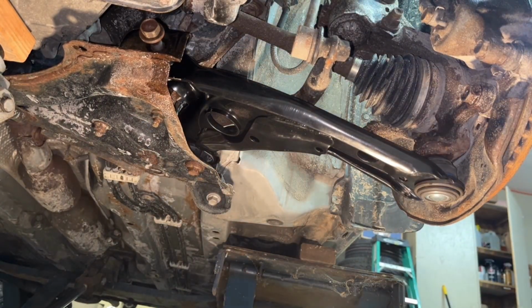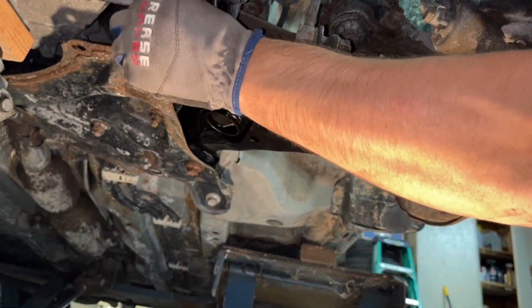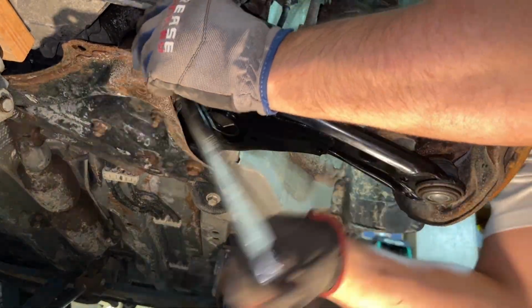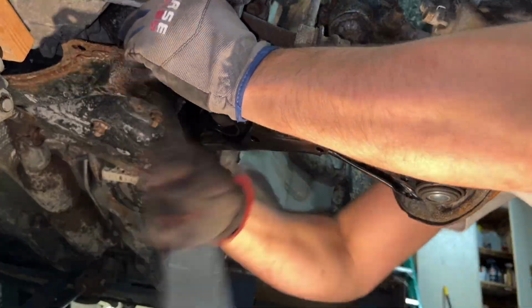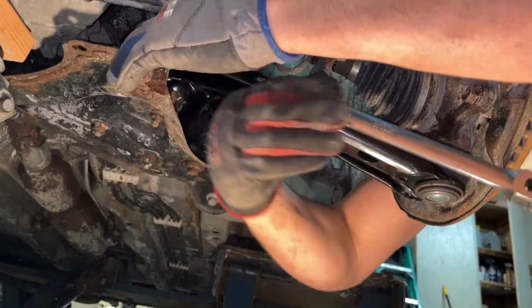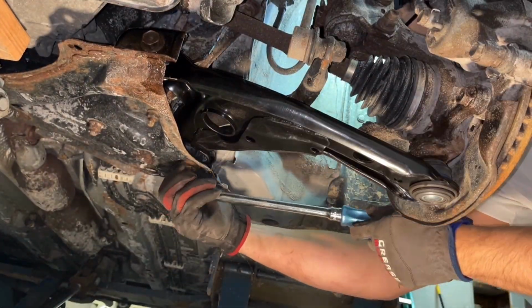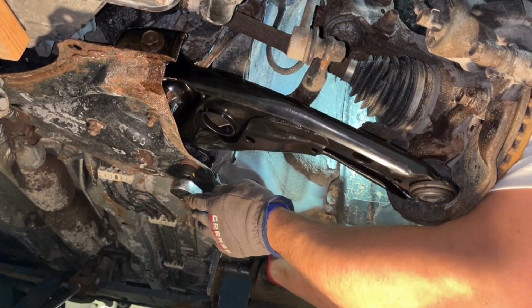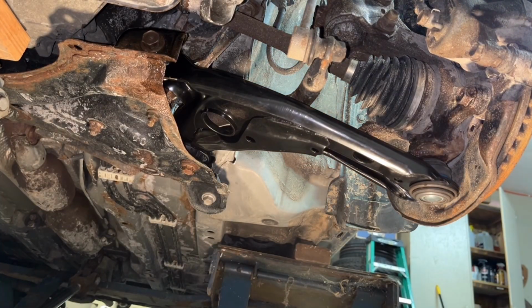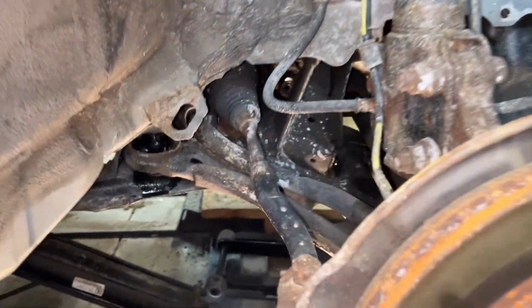Just a little light tap. I didn't force it in there. And you want to get that snugged up, but again, not torqued down. I actually have no idea what the torque specs are on this, but just from my experience, nice and pretty snug is sufficient on these guys here. That bolt should be pretty tight because that is located in the lower subframe assembly.